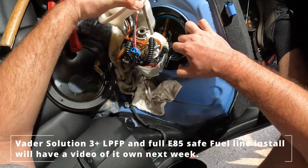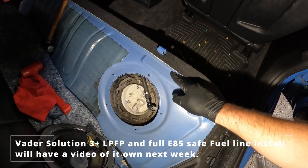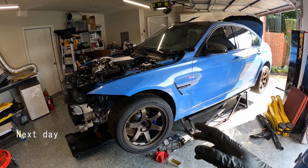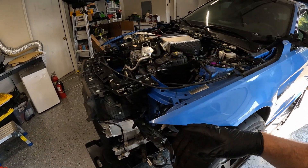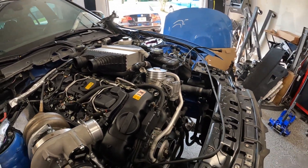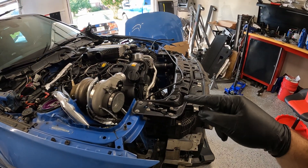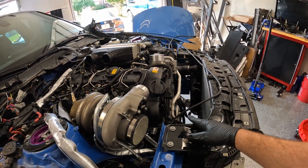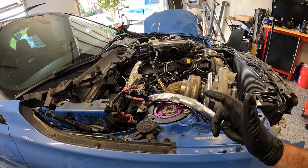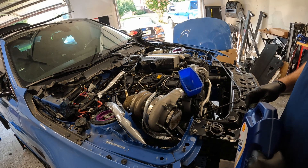In she goes. You want to try to get it over to the passenger side which has the same indentation as the other side — it's literally right here, so you want to shove it as far up as possible. I already pulled mine just to be safe. Missing a couple little things to get it actually running, but definitely able to do a startup to make sure everything's good before finalizing all this stuff up here, because I don't want to have to take all this off if I find a little leak. To chase down any wiring problems it's a little easier to get to, so we're going to pour some oil in, rotate it by hand to get the oil pump circulating, crank it without injectors and coil packs to circulate more oil and build fuel pressure, then do an actual startup.